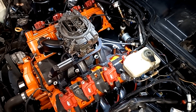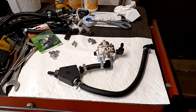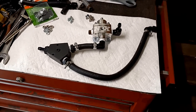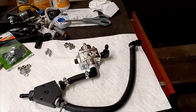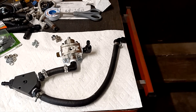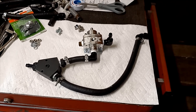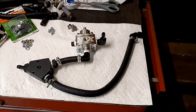For the carburetor fuel system on this 944 — the 944 has an electric fuel pump from the factory that sits below the tank. According to guys who race 944 Turbos, it'll support about 400 horsepower, and its fuel lines will support about 400 horsepower too. That's the main reason we just left that system alone.